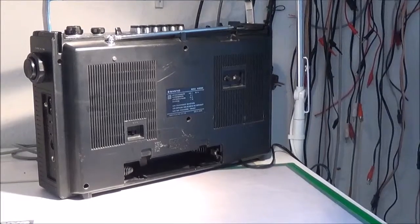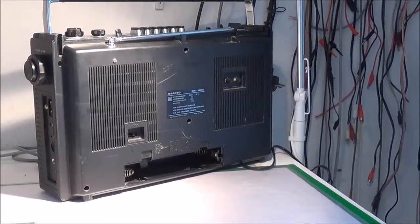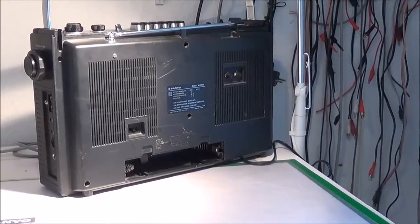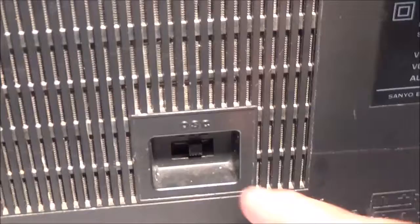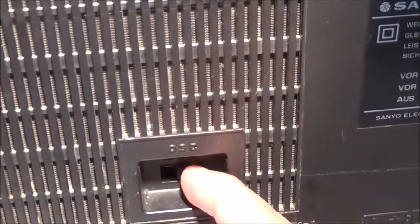Here's the unit from the back — doesn't have anything in particular worth mentioning, but it does have two terminals on the right so you can hook up a 300-ohm dipole antenna. Just in here is the oscillator switch that's used when recording from AM to stop interference.